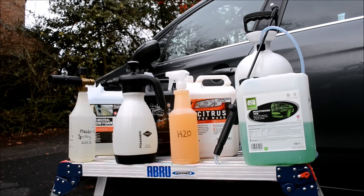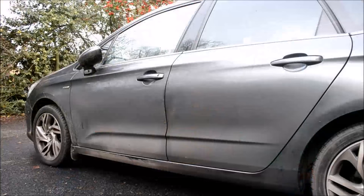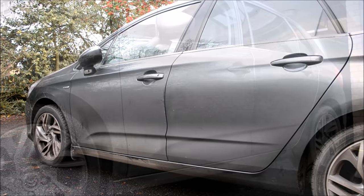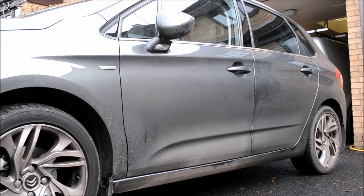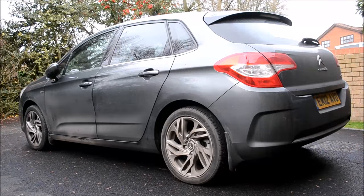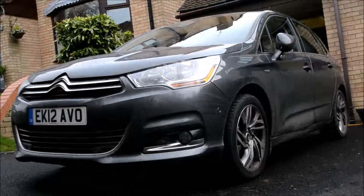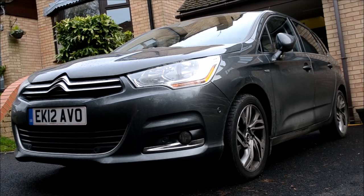The pre-wash stage is designed to soften road grime, loose contaminants and general dirt on a car's bodywork, so when followed with using a pressure washer will aid the removal of loose contaminants before a wash mitt is used. Using an effective pre-wash will make your contact wash far less likely to inflict swirl marks, wash marring and fine scratches. The idea is to get the car as clean as possible before making direct contact with the paint.